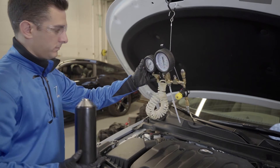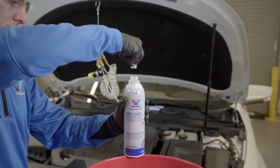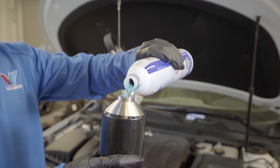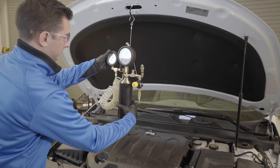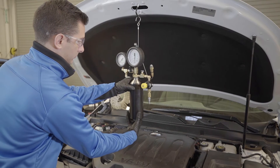Remove the canister from the VPS Complete Intake Fuel Rail device and fill the canister with the VPS All Engine Clean Intake Cleaner. The VPS All Engine Clean Intake Cleaner is introduced into the air system through the map sensor or via the throttle body using a highly atomized sprayer adapter. Reinstall the filled canister to the VPS Complete Intake Fuel Rail device and hand tighten.